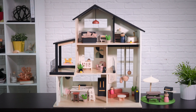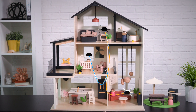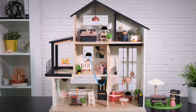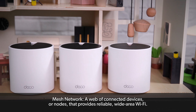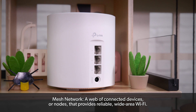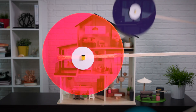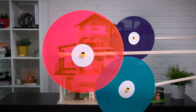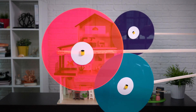So what's the solution? Well, you could knock a bunch of holes in your walls and run ethernet cables and wire up a bunch of commercial networking gear. Or you could replace your wi-fi setup with a fancy new mesh network. Mesh networks utilize multiple access points, also called mesh nodes, connected to each other using either dedicated radios or wired ethernet if your house is equipped with it. When set up properly, mesh networks will seamlessly improve coverage throughout your house and get rid of dead spots once and for all.